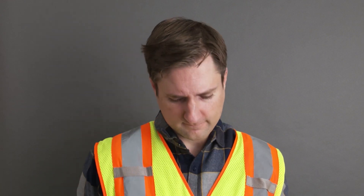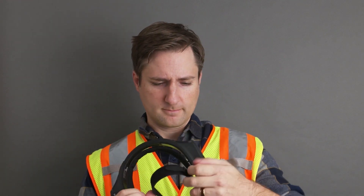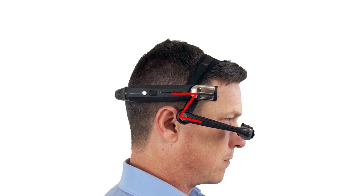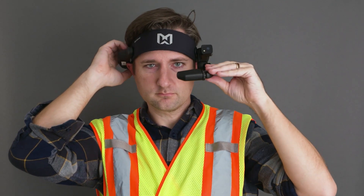Which are you? Now that we know which eye is your dominant, let's go ahead and try on the device. Go ahead and flip over the device since you're left eye dominant, and make sure to adjust your head strap so you can be comfortable. When wearing your device correctly, it should always rest above your ears and stay parallel to the ground. When adjusting your device, start with a Z formation, then move it from there. You should be able to easily look at your work ahead of you and look down at your screen. Most people find it comfortable to wear the device with the display pod resting right below their dominant eye.